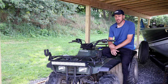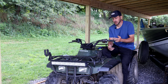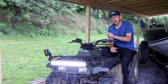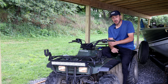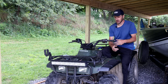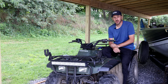All my wiring is complete. Let's check it all out. I'll turn the key to the four-wheeler first — no headlights because the headlight switch is off. I turn on the on-off switch and you can see I get my factory low beams. Now over here I also have a high-low switch. Turn it to high — boom, there is my LED light bar just the way I wanted it. Back to factory low beams. And with my LED bar on, if I turn the key off, they're off — exactly what I wanted. No worries if I left the switch on. The only thing left to do is clean up all my wiring.